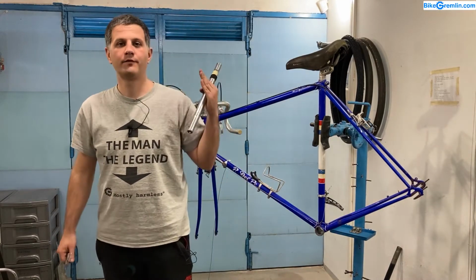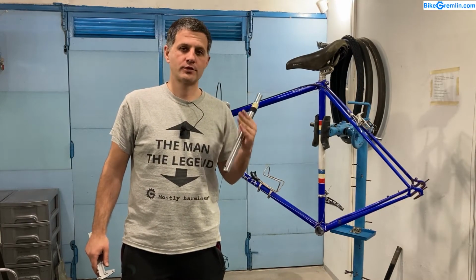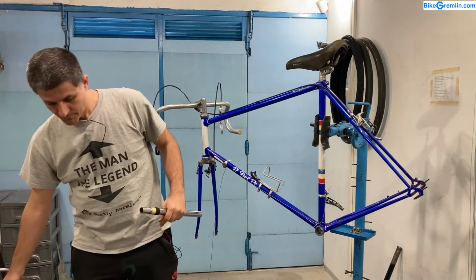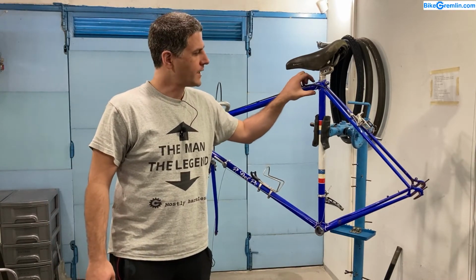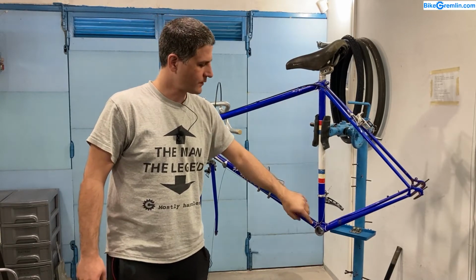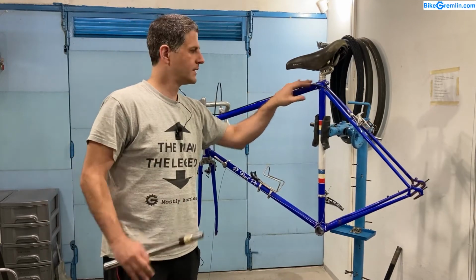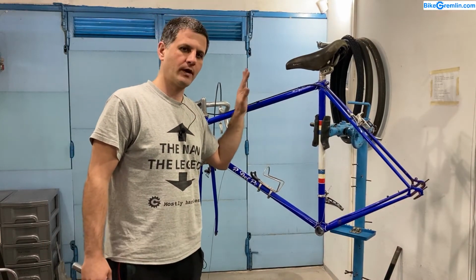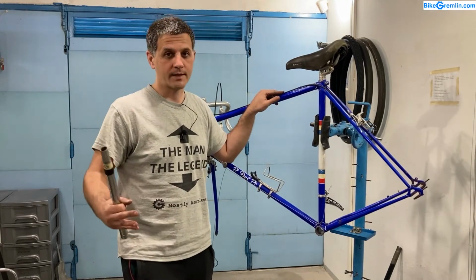However, with high-end frames, manufacturers try to make them as light as possible because that is what sells. So some of the tricks they use are to keep the tubes a bit wider and have slightly thicker walls near the ends where they are joined together, because those areas are of high stress, while they make the midsection with thinner walls. That allows them to keep the frame strong and stiff enough without being very heavy, making it light.